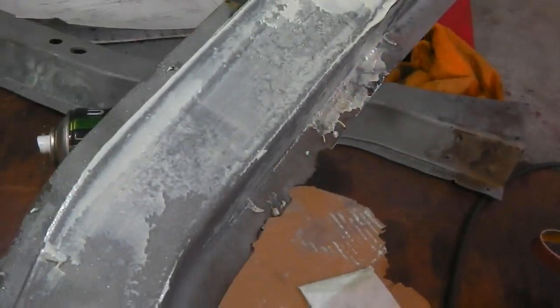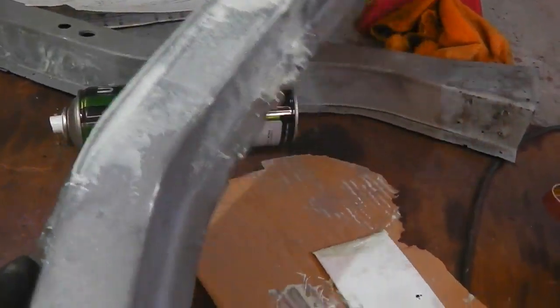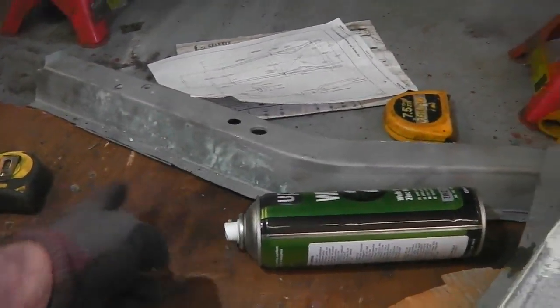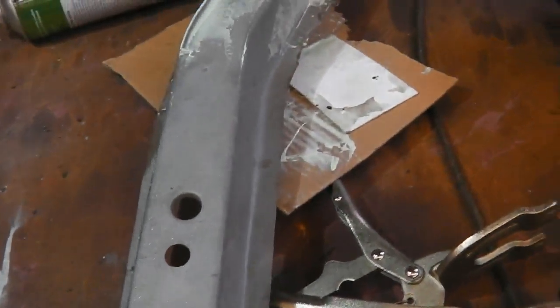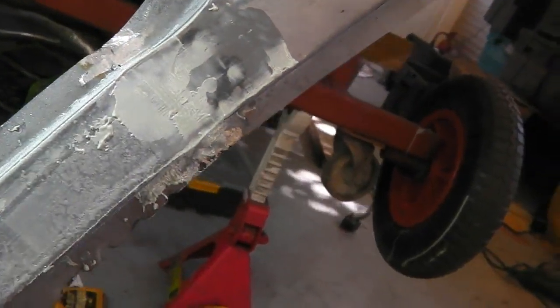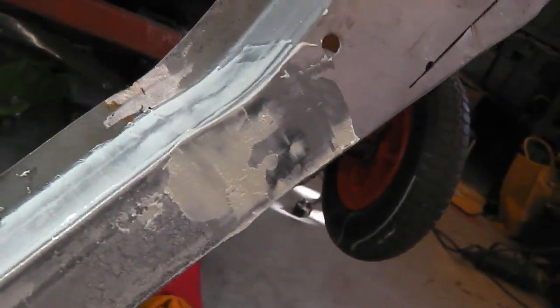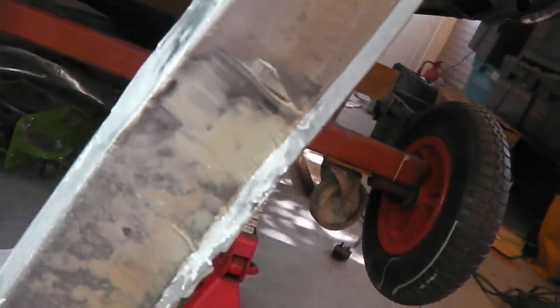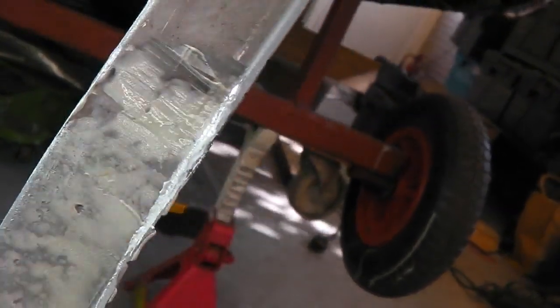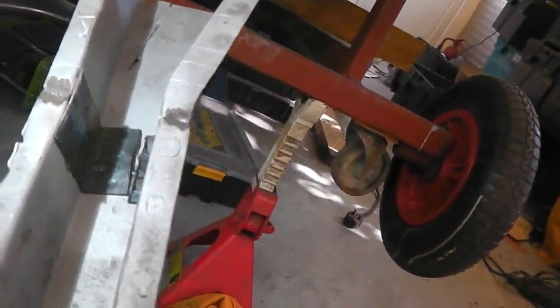Alright. Okay, so the plates are in there. We'll just wait for that to cure before we sand it back. If we wanted to, we can go on to the other panels. I've done a little bit there, just for any pinholes. I mean, this is getting covered in Gravitex, so it's really academic how far you go. But the Gravitex would not have hidden that weld line, even with my butt weld back there and then ground back with the crocky. You could still just see the line.